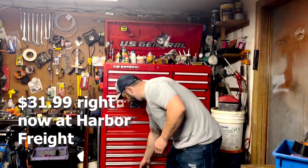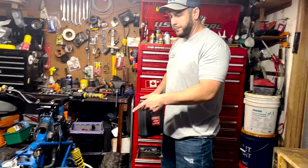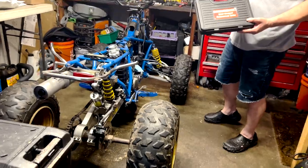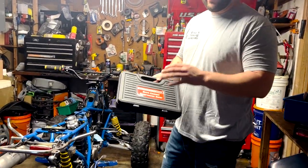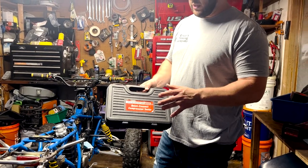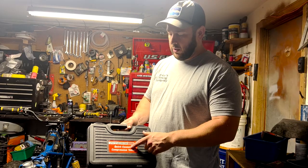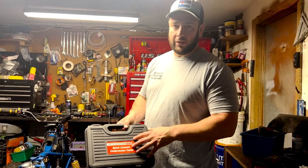Today I want to make a quick little video on the Harbor Freight compression tester for an engine. The other day I used it to check the compression on a new four-wheeler I got, and it seemed oddly low for how it felt. And then I tested a dirt bike I have, a little CR125, and the compression came back at 60 PSI. Did a little research online. Apparently these things only tell you half what the PSI really is. So I want to do a comparison between both testing kits and see if this thing is junk.